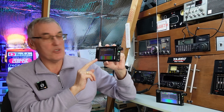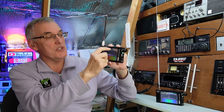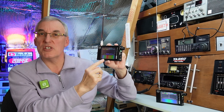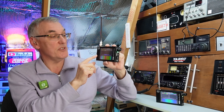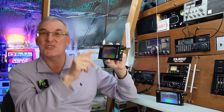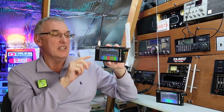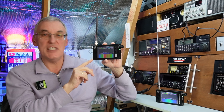Like all these China products, there are a few idiosyncrasies — a couple of things that can be a little bit odd. As I mentioned, when you touch the screen and type in frequencies, every now and then it gets a little bit out of sync and you have to switch it off and back on again — it loses registration somehow. Then there's the clock: I don't know how you adjust it; it might pick it up from FM, but I'm not on FM much. When I switched it off and recharged it, the clock would just set a random date. It didn't bother me, but there it is. It's been on the market for two years and the price has come down and down, so grab it while you can.